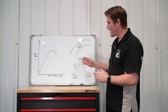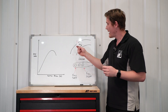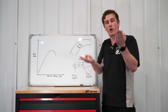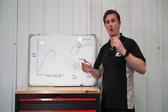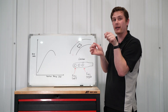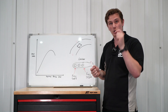When physically tuning an anti-roll bar we need to look at where in the corner we're having an issue: corner entry, mid corner, and corner exit. An anti-roll bar is most effective when tuning it at the mid-corner section, because as a car goes in and out of a corner the dampers are going through their range of motion and can be tuned for corner entry and exit. However, in the middle of a corner the dampers have stopped compressing — the car has reached the apex where it's settled — so at that point your anti-roll bar is extremely effective at controlling the behavior of the car.